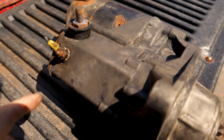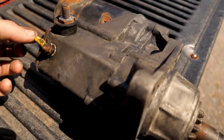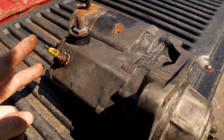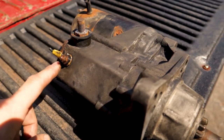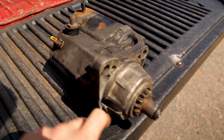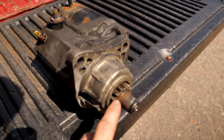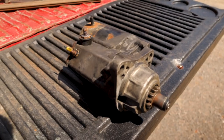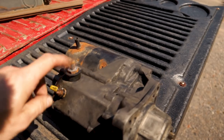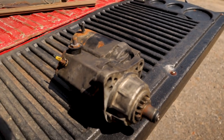You know it's bad when you go to stick your eight millimeter socket on there to break that nut free so you can take the lead off, and the whole thing just starts to spin around. I ended up having to clip that wire and recrimp on a new end so that we could attach it to the new starter. Aside from this busted stud and the teeth on this gear being a little chewed up, this starter should still be in relatively okay shape with the new studs, contacts, armature, and brushes that we cleaned up inside it just a few months back.